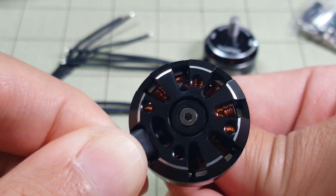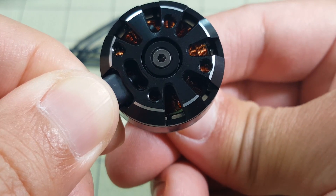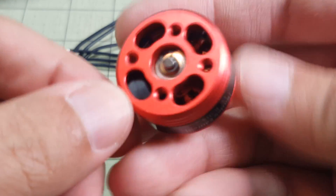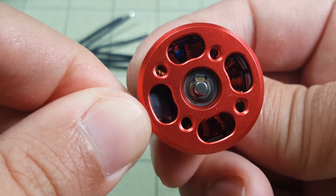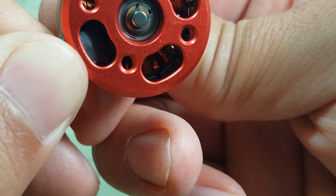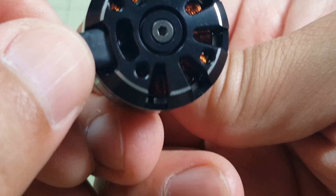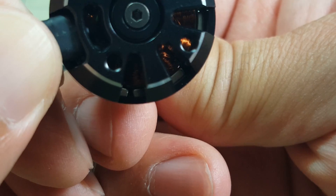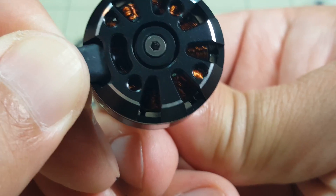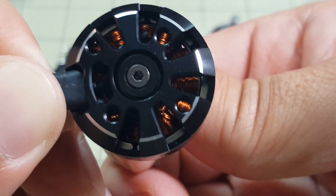It's hard to see what the magnets look like in this lighting. Looking down into the motor, you can see that the spacing between the magnet and the stator is quite a bit thinner than on the old version. On the old version there's actually more space between the magnets, so there might be fewer magnets. It's kind of hard to tell without taking the motor apart. It does seem like the tolerances are better, and definitely the magnets are closer than the old version, so it should be able to produce more power.